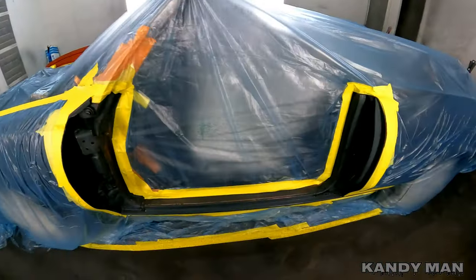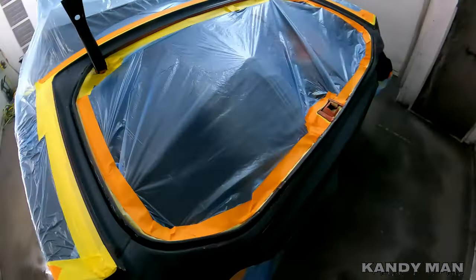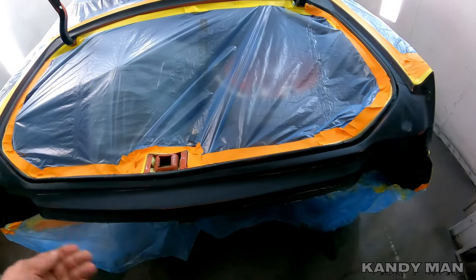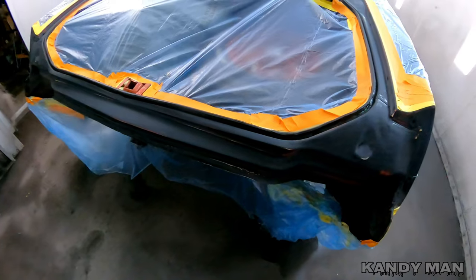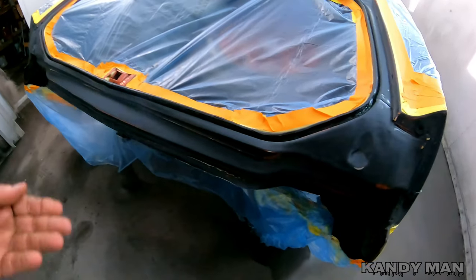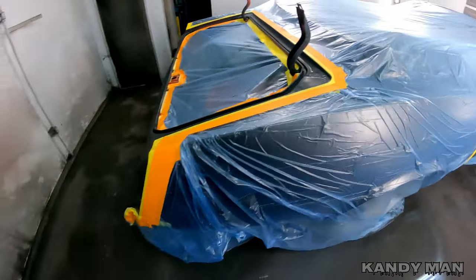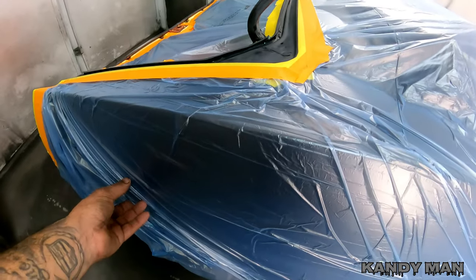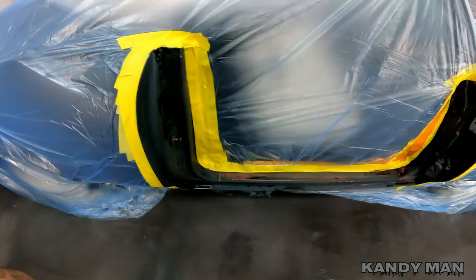We're all bagged up and ready to go. It's cleaned, it's wiped, and I just got to tack it now. This back here was being a pain because the car is all undercoated — I couldn't get nothing to stick so I had to use magnets on the bottom. If you guys get into a bind with some of these older cars and you can't get stuff to hold, use magnets — it actually holds up to the metal even if you can't get the tape to stick. You can even use the magnets in some of these cross-flow booths on your plastic to keep it from blowing in the wind.